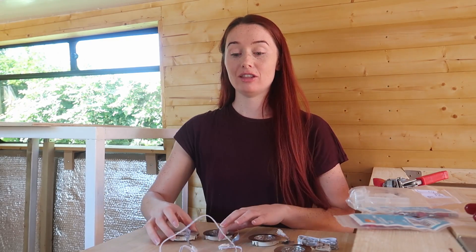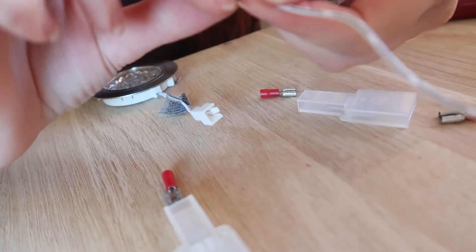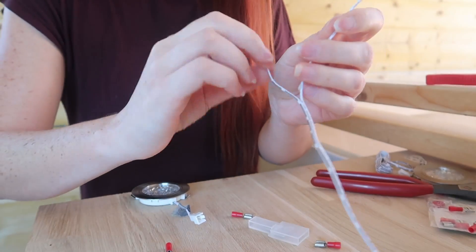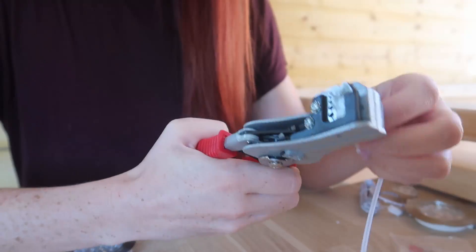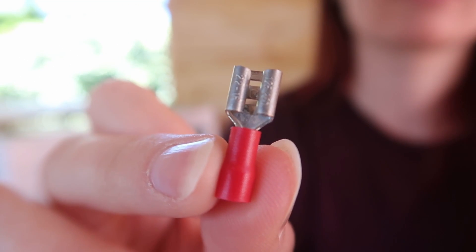For our lighting we're just going to use these four LED lights. These have come free-wired so we actually have to cut the wire, strip it back, and wire it how we need to. I'm going to start by connecting the first light to the second light — just cut the wire of the first one, peel the two apart like that, and strip the wire. I'll then add a female crimp connector on both ends, feeding the wire through a 1.5mm female crimp connector and using a crimping tool to crimp it into place.